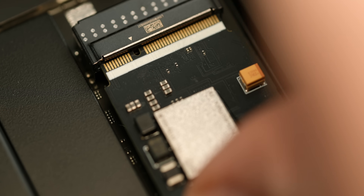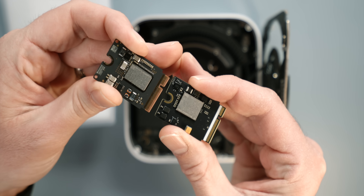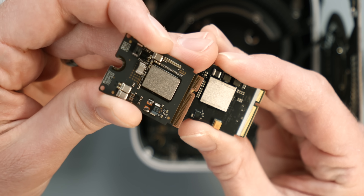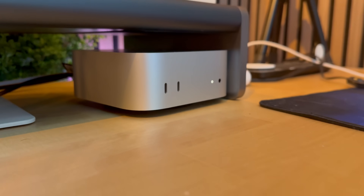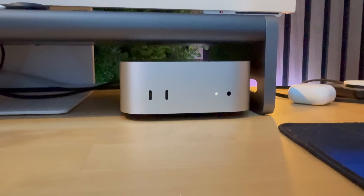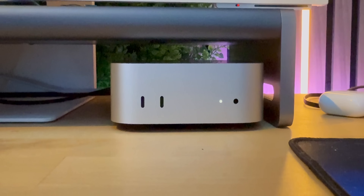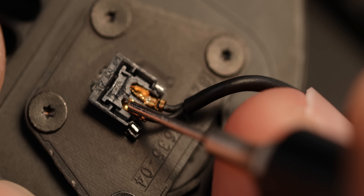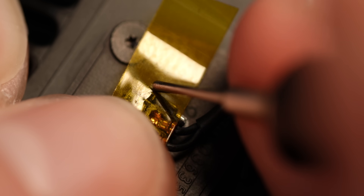With the old SSD out, we can place in the upgraded drive. Comparing the two, there seem to be fewer components on the upgraded chip, so let's hope it doesn't affect reliability — my home M4 Mac runs 24/7 running Home Assistant, my media library, and is in constant use day-to-day. From here everything goes back in the way it came out. For a temporary solution for the broken power cable, we're using some Kapton tape just to keep the pins secured.